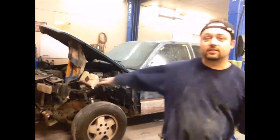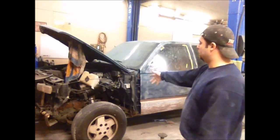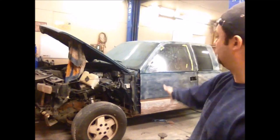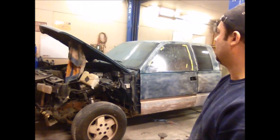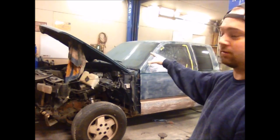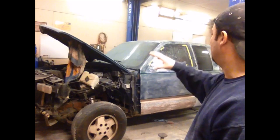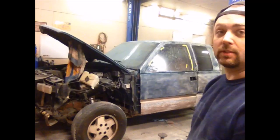We're on to the rest of the truck. I've got most of it sanded down with 180 grit sandpaper. This fender had some rust in it so I'm going to replace that fender. I'm going to pull the other fender off so I can paint the hinge side of the door effectively when we paint the truck. The hood mounts to the fenders, so if I take off both fenders I have to take the hood off too. I'll get the truck completely blown apart, get it cleaned up, and hopefully get the main cab and doors in primer today.